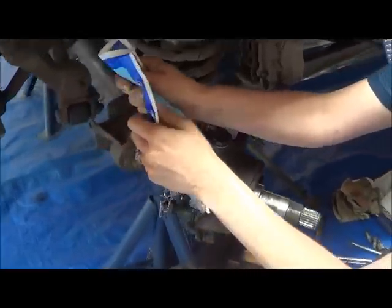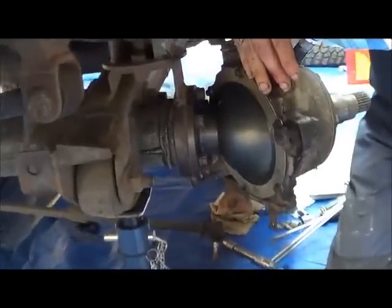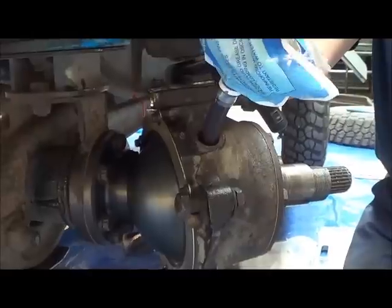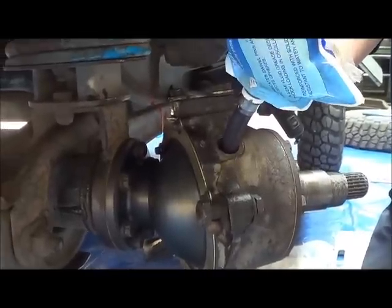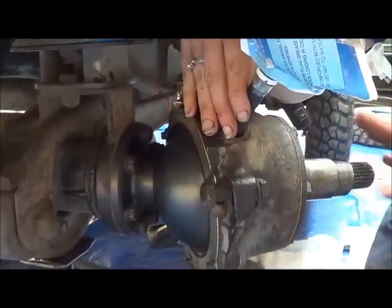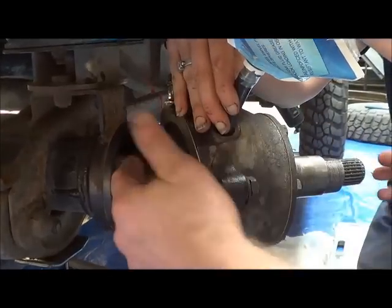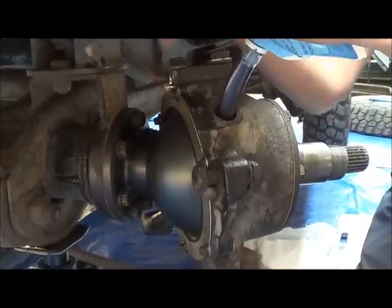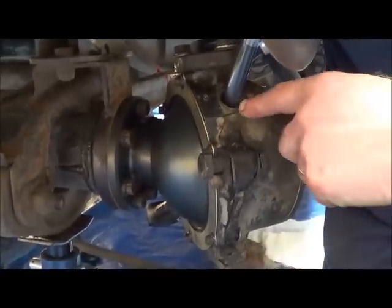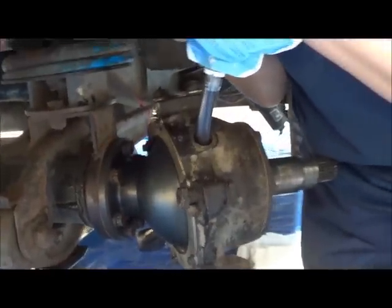And it's a grey sort of lithium-based grease, basically. So it's thicker than oil, but thinner than bearing grease. Oh, cool. And also you need to have the swivel pointing this way when you're filling. If you have it pointing that way, you will be up against the ball and it will immediately all come out, because you're going to be squirting it directly onto the ball. Whereas here you're squirting into the gap in the middle.